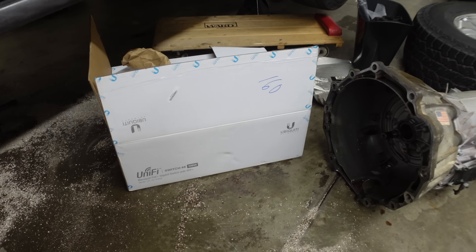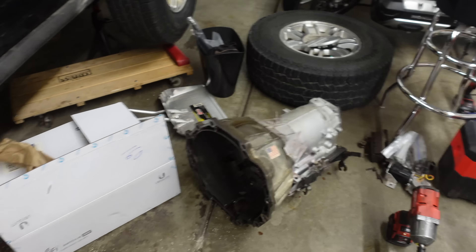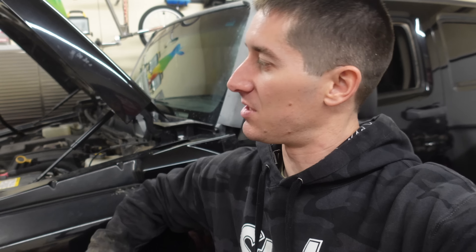We're going to use a cart to put the transmission on so we don't spill any more oil, because obviously we've created a gigantic mess underneath this thing. There's the converter — the old one that's going away. What a wild wild job. This is by far the hardest 4L60 drop I've ever had to mess with in my life. The transfer case was no big deal, but the transmission itself was actually kind of a monster of a job — it just doesn't want to come out. The tunnel is a little too small, and the starter hump is on the wrong side because of the special bell housing — it's on the top instead of the bottom. A lot of stuff fought us, but we finally got it done.